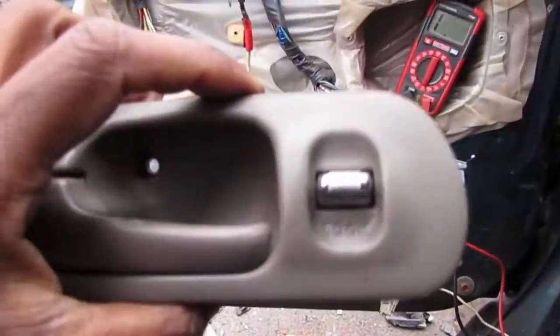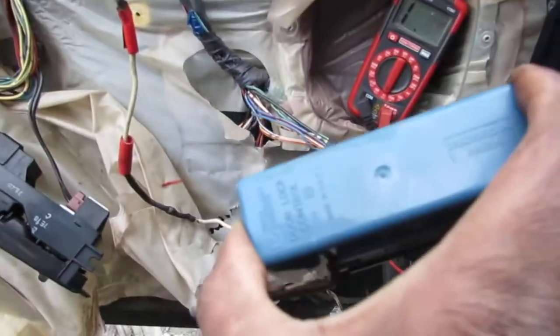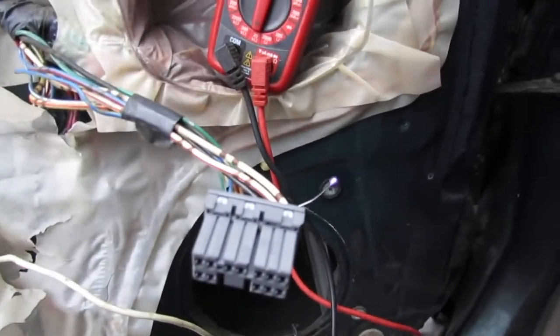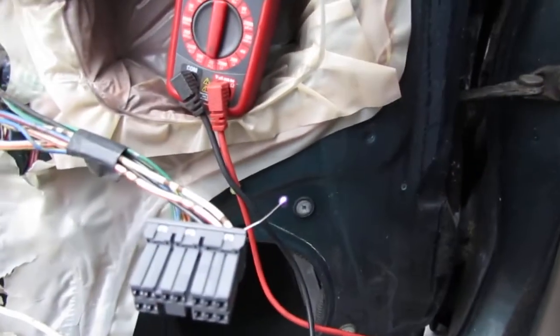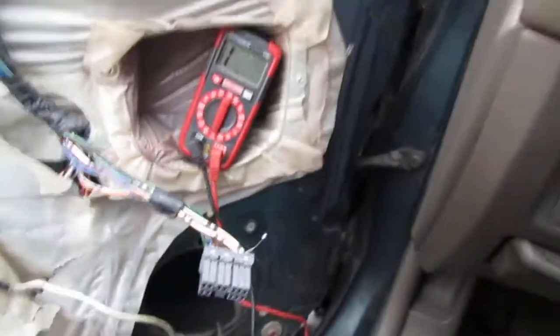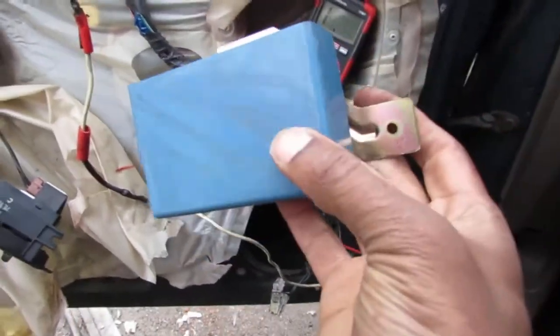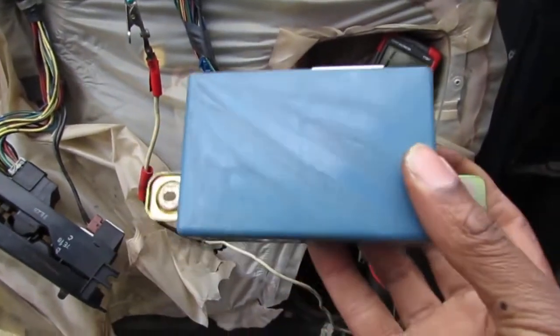We know that the switch works. That switch works, I mean, sorry, you know, the switch. This. That works, right? We know that the switch wire coming all the way down into the door lock control works. There's continuity, right? We are not getting output from the door lock control to here. That's a problem, right? So if I'm thinking about this correctly, this is our point of failure. That's it. Yep. That's what I'm thinking right now.